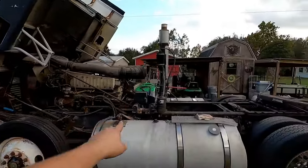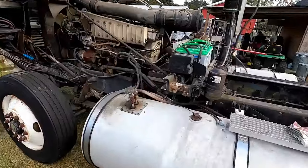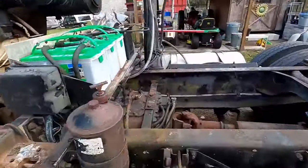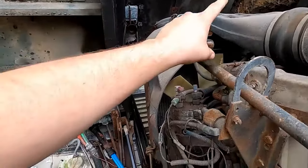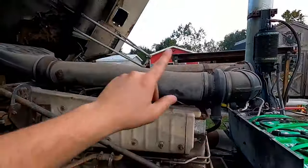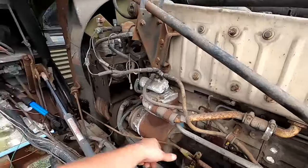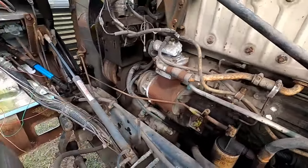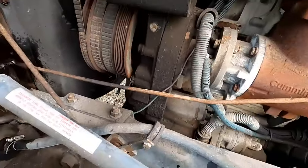We got the cab all jacked up — went nice and easy. Now we've got our hoses repaired. I did bring my Milwaukee electric grease gun with a couple tubes of grease from the shop, because there are grease fittings everywhere on this thing — on the pins for the leaf springs, on the steering, on the U-joints, on the shifter linkage for the transmission, which is a little stiff. We're gonna be greasing all that up today. I also got a new fuel filter to change, and I need to lube up the throttle linkage inside the cab because it's a little stiff.